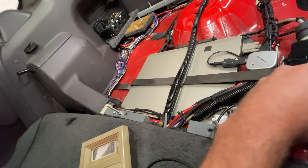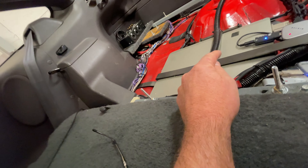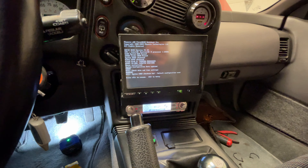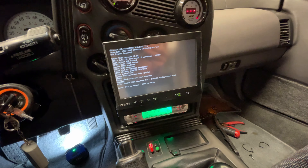Now let's see if I can even turn the laptop on, which is basically got to hold this green one down, then let go. There it is. Now that's beeping because I think I've got a low battery in the CMOS in the front — that's normally what happens. I have a feeling the battery in this is dead, but it should run off the 15 volts. Here we are — we're going in right now. It's saying press F1 to resume, F2 to set up. I need to put a battery in this perhaps. Anyway, we've got a screen — that beeping is quite noisy. Let's get things fixed up and then I can show you how this is all going to work when it's hopefully all back together.